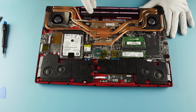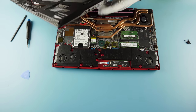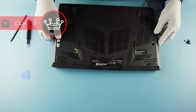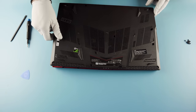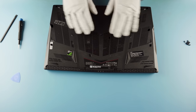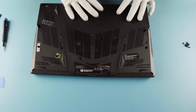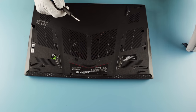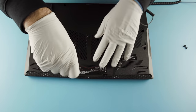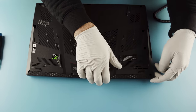If you do want to remove the battery, one last note is you'll only need this one screw here and the battery just pulls directly out. Other than that, put it back on. Again, you want to make sure you take this side that has the molded plastic that goes around the ports — you want to get that seated around your ports first. Then from there, you just give everything a good press. We'll make our way around, put all the screws in, and then we'll check our seams.